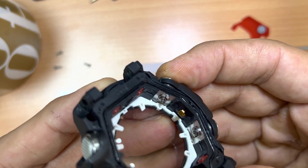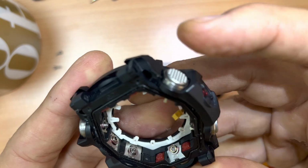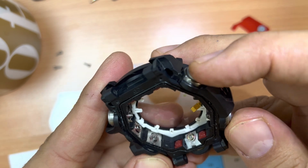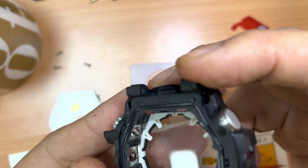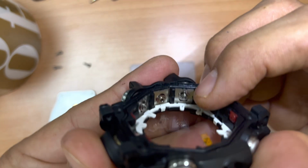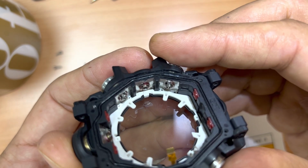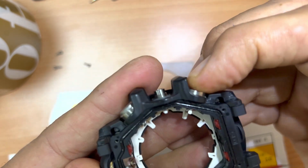On one of these little pushers, there are 2 C-clips holding it in place. One of them holding the actual complete button assembly in its housing. The second one holding the pin within the pusher within the cylinder itself. So I'm gonna try to pull it out. What I ended up doing, by the way, I got one of those little vape coil 316 stainless steel wire. I don't know what gauge, I think it was a 13 gauge if I'm not mistaken, and I ended up using it as a C-clip, and it's been holding in really well.